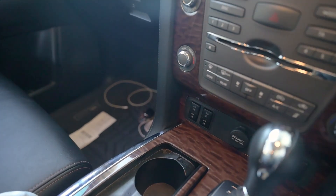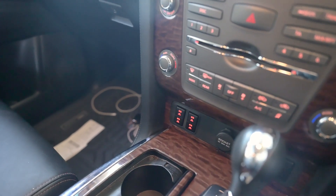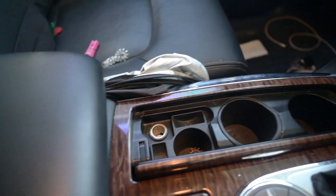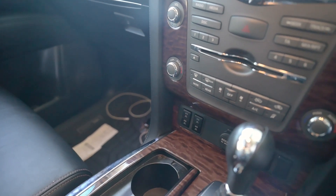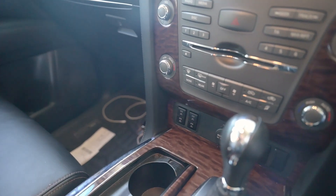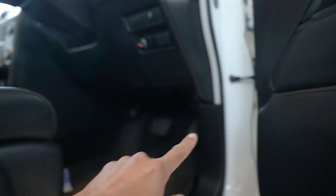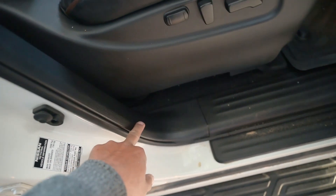I've got the switches there. To get power for the lights I picked it up from the cigarette lighter - I found the cable that was powered when the lights were on, then ran that under the dash and hooked it up. From there the seven-core goes behind the dash. I opened all the dash through here, ran it down into the well, pulled all this off, and it just runs under there.